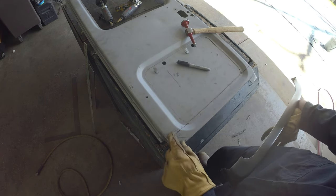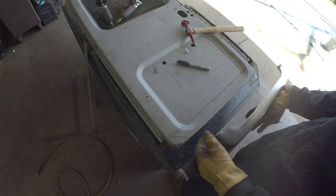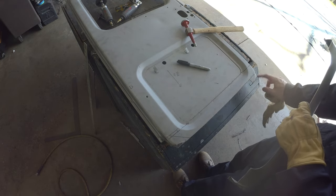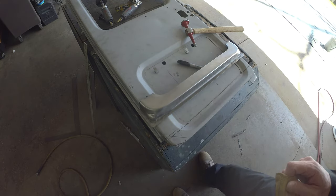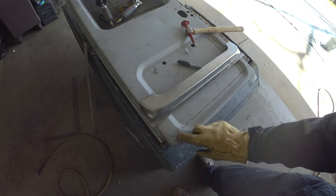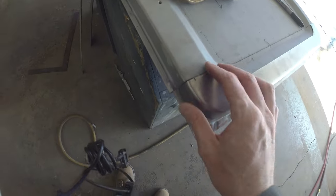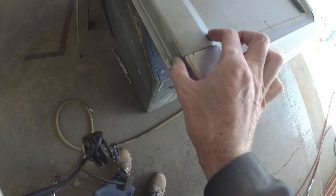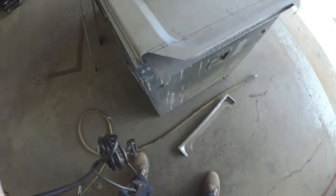So I'm going to nibble this corner off, probably going to do this at 45. We'll make that match up. Then we can match up this line all the way across. Then we can come down, cut this square, and work this flange across. This corner is actually pretty stable. It's not perfect. It's got a little bit of pitting, but it's going to get hidden under that flange. So I think that's the plan. Better to do something than do nothing. So let's get cutting some of this off, start working that in, and see how she fits. Kind of learning again as we go, but another probably good reason to nibble off and keep the other corner. So if I set this one basically flush, or throw it up.